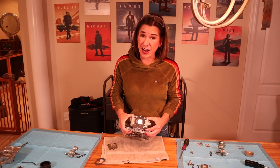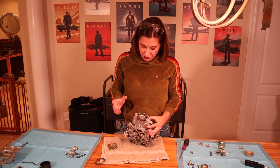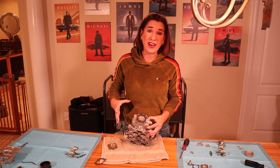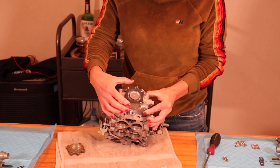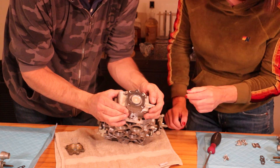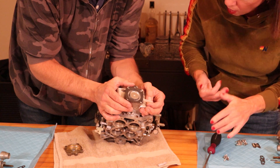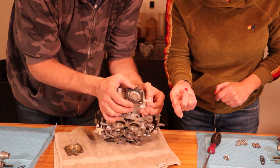Okay, it's secondary diaphragm time. This is kind of the most annoying part of rebuilding the carb and kind of the hardest. I'm going to need Dee's help just to kind of hold it up — the reason why is because I don't have a vice right now to stick this in; it'd be a whole lot easier if I did. You guys see this really flimsy piece of rubber here — every time he pulls that lever down it sucks in, and we don't want that, like a little tiny woofer. Eventually we'll have to put the screws in there, but this is the most aggravating part right here.